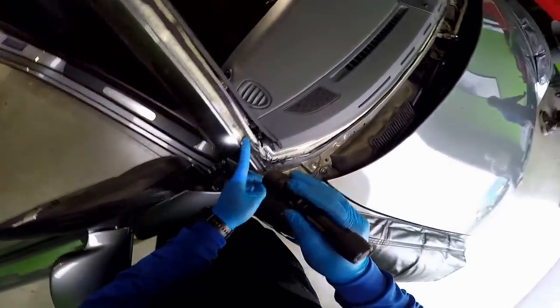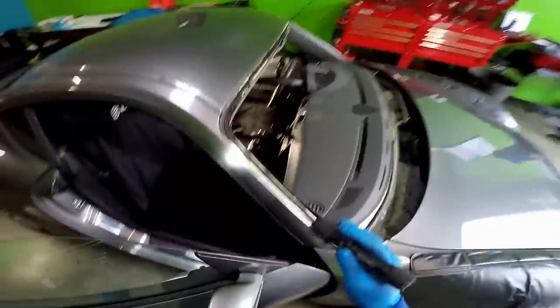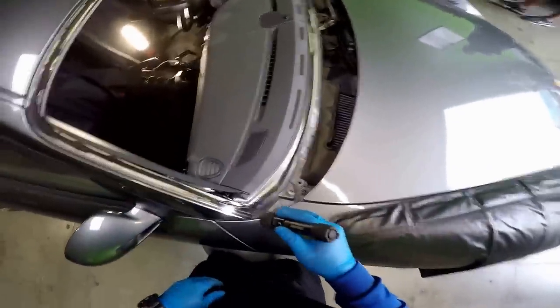And I think it's already eating through underneath the urethane, so on this spot right here, I'm gonna remove the urethane so that I could see what's underneath there. This mark right here, the urethane squeezing out, tells me that they had a hard time setting the glass.